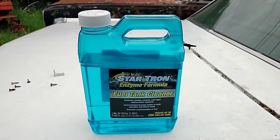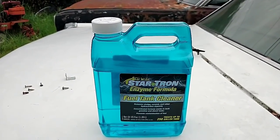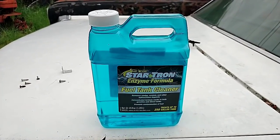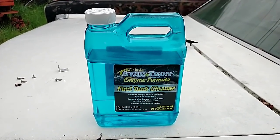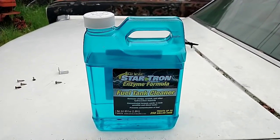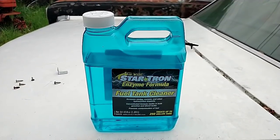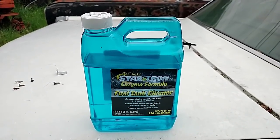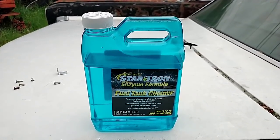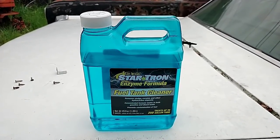And then you have the problem, of course, that there's no fuel getting up to the fuel pump because everything's evaporated out of the lines. So as ghetto fabulous as it is, I took a shop vac and pressurized the fuel tank with the exhaust of the shop vac. I had a catch can up top and I just pushed the gas up to the fuel pump, and then once it was checked there, I pushed it up to the top of the carburetor, again by pressurizing the tank. It took a while, but it worked.